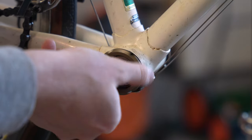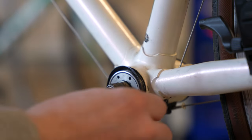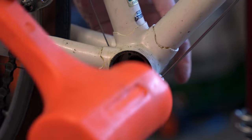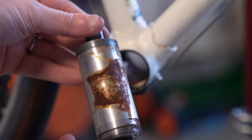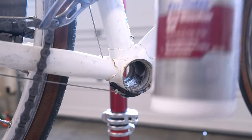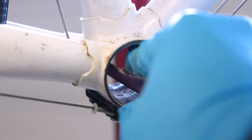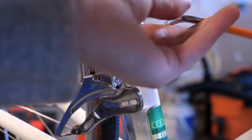That Mavic Starfish crank includes a really interesting bottom bracket — a discovery I made after starting to tear down this bike. These 610 bottom brackets are actually not threaded into the bottom bracket shell; rather, you face the shell. It's a floating bottom bracket, which is awesome for frames with corroded threads and is very long lasting, but it's not what I was looking for. We did have rust in the bottom bracket shell, so after removing it, I did some rust removal and took it to a shop to have them run a thread cutter through to clean it up.